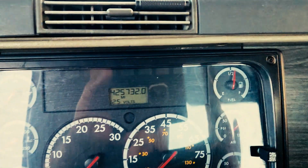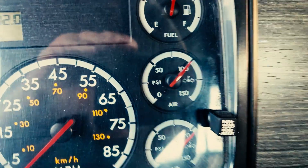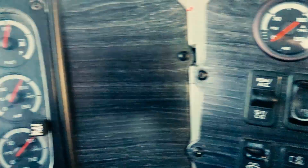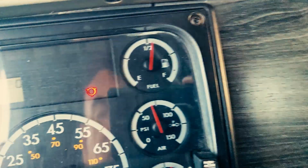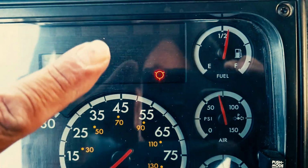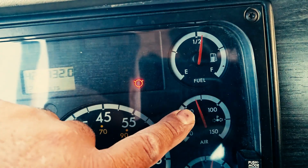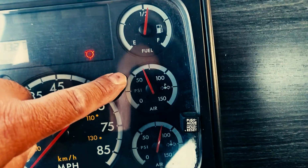So you're going to demonstrate that your emergency warning light and the buzzer are functioning properly for your low pressure warning. So let's fan our brakes and drop the pressure. Now when you're fanning your brakes, you do it at this pace. Do not try to go fast. Now as you can see, my low pressure warning light and my buzzer came on when the pressure fell at 60 psi, which is before 55 psi. You would tell your examiner, this vehicle has passed.